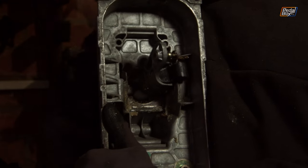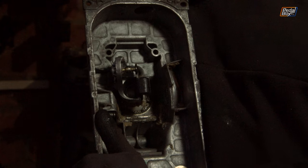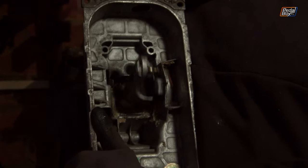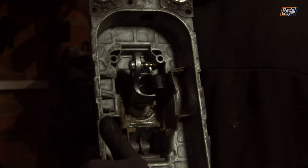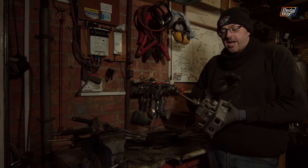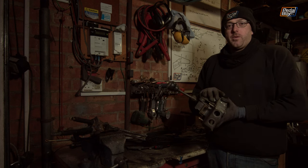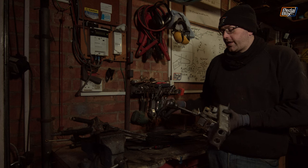The lockout won't allow you to engage reverse gear until you're in the neutral position — back here — and you push down on the stick so it can get past and around this little moulded section. If we simply turn this around the other way, reverse would be all the way across and you could very easily drop into it. Similarly, trying to go for fifth or sixth, you'd get interference. We could just remove the block and it would probably work, but I really don't like the idea of getting into reverse so easily — that's the fundamental problem with the mechanism.